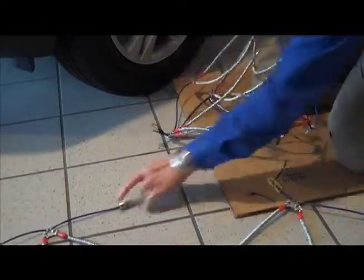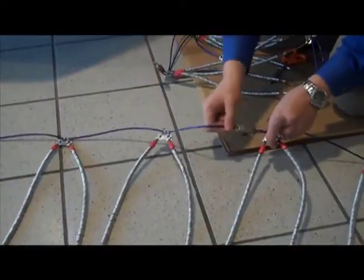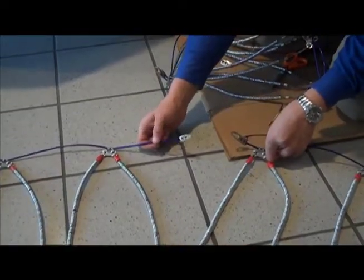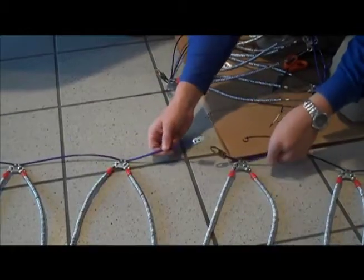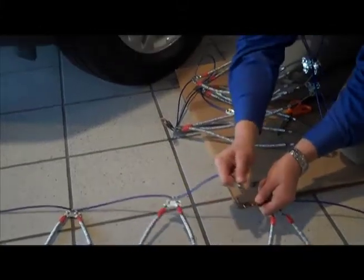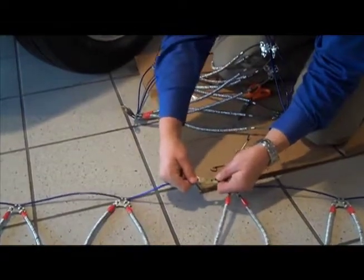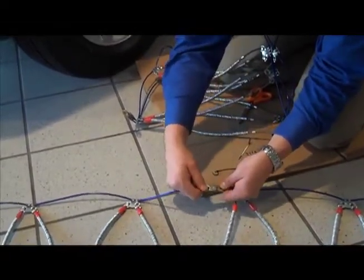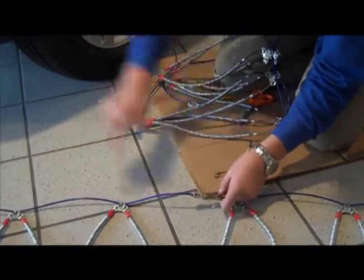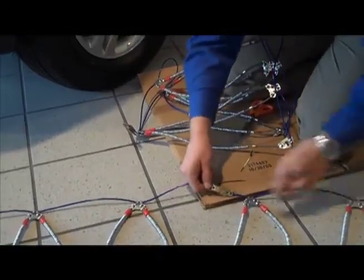You kind of see here where they break apart on the back side. This is so that you don't have to drive over the chains. The old style used to be like this and you drive over. Now these have the breakaway. So this breakaway is going to go on the back side, inside of the tire. You'll reach around the tire, and then it's an eyelet connection that goes in at an angle, then turns and locks. So it won't come out, and you won't be able to put it in and pull it straight through either. You have to be at an angle, turn and lock. Okay, now that's going to be behind the tire on the inside. Okay, so with that, let's put these babies on.